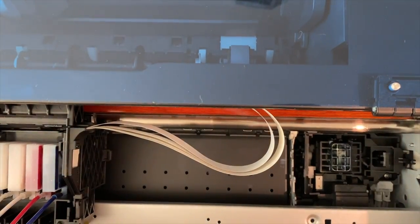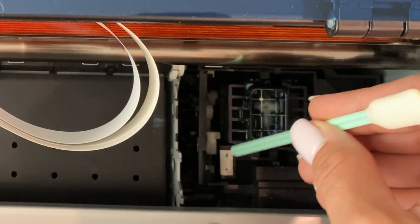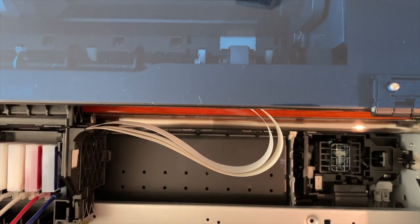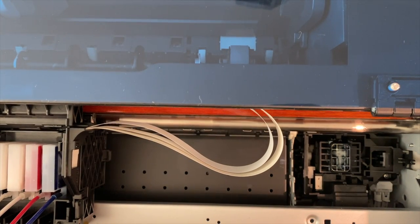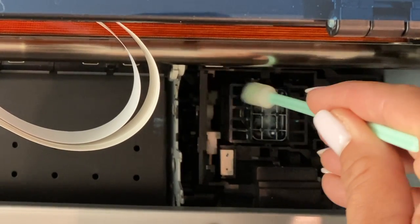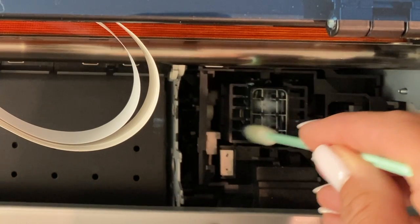You're going to have to use a little bit of arm muscle there to move that. This exposes two of the areas that we want to clean on a daily basis after using the machine — one is this area right here where ink may be gathering, and the other is this area down here where we are going to expose the wiper. Both of them can be cleaned with the cleaning solution. Put a little bit of cleaning solution on the tip of a swab and then just clean this area right here to remove any excess ink that might have gathered. You can see my swab has some ink on there.